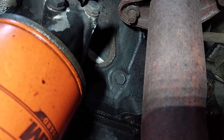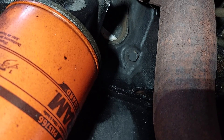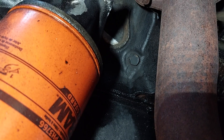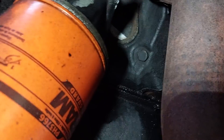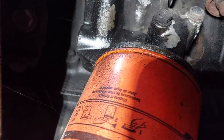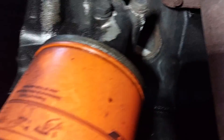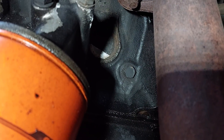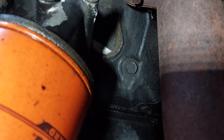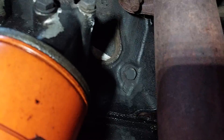We've got about four gallons out of the radiator. We're going to try to get some out of the block. There's a bolt front and center on the driver's side of the engine block next to the oil filter — I'm pretty sure that's a block drain. There's also a little square jobber over there; I think what happened is that one got replaced with a standard bolt at some point, and I can see some Teflon tape hanging off it. I'm going to crack that open — I think it's a 9/16ths.